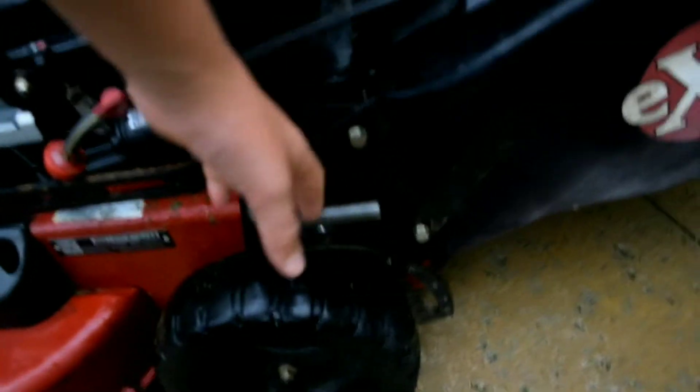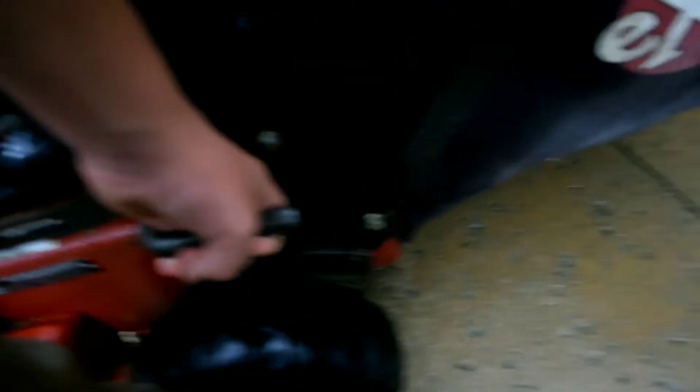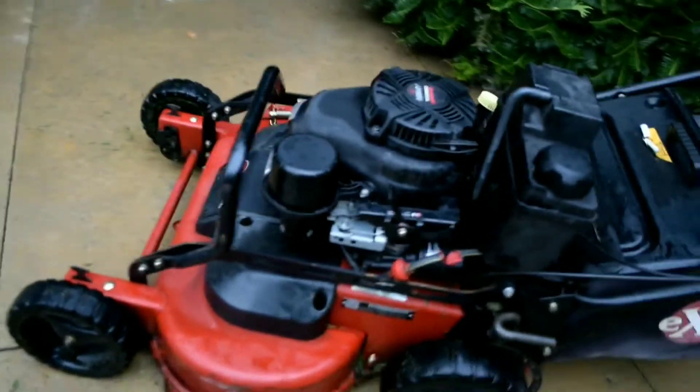This is how you turn it off — that would be what you would normally mow on. You can see it's on full, and then if you were to cut it off you bring it all the way back to the stop position. It's got the fuel filter, oil filter, and then you've got your bag, of course, which is a little raggedy — I'm probably going to buy a new bag, but it gets the job done. For the back, this is how you raise and lower it: you grab this lever, you pull up, and to lift it up higher you pull further and let go and it'll go back down. I keep it on about two and a half inches because it's just a good cutting height in my opinion.